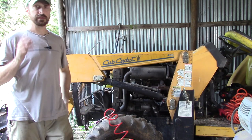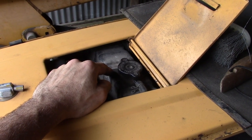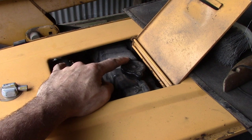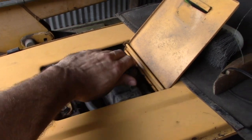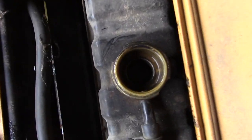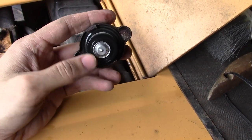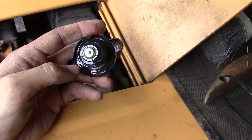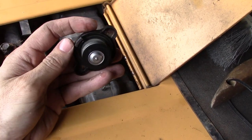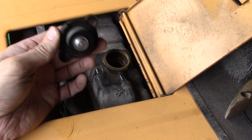One of the last things to check for is your coolant level. Now make sure when you check your coolant level, you do not open your radiator when it's hot — you will scald yourself. Absolutely do not do it. Wait until the engine is completely cold to open this up. We're going to look down inside and see that our radiator is nice and topped off. You can also look on the inside of your cap and look for any kind of gumming or really dirty coolant. This one, as you can see, is beautiful — very clean, so we don't have any issues with rust buildup in our radiator right now.